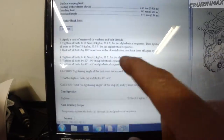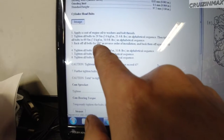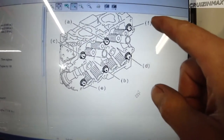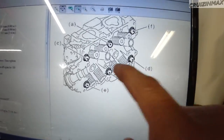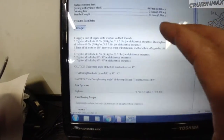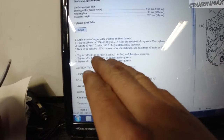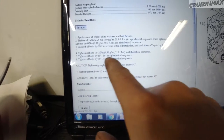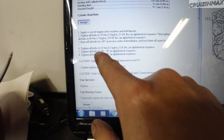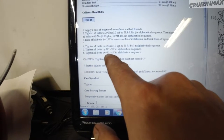Then you back it off by 180 degrees - I'm gonna use a breaker bar for this - in reverse order of the installation, so it's F, E, D, C, A, B. Just reverse. Then do 180 again. That's a gasket crushing procedure - they'll all be loose by the time. Then it's back to tightening, A, B and so on, to 31 foot pounds.